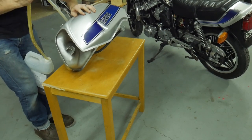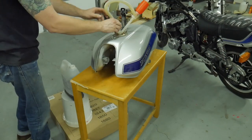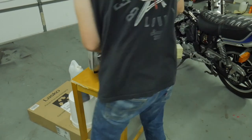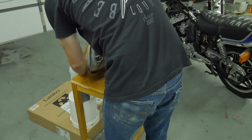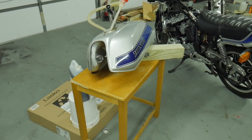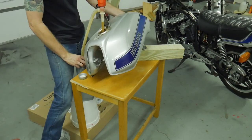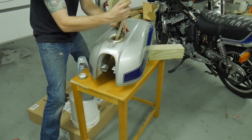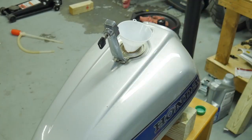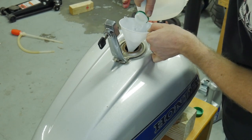Something like distilled vinegar is what I use here. We've got about five gallons and we want to fill it up to the brim. This is me sucking out the old residue. You'll see a technique I use quite a bit, which is just trying to puddle or pull everything to one side. The main issue with using a low acid as a cleaner is that it does etch the metal — etching the metal is a term used when you cut into the protective coating of metal that's inside of tanks, leaving an imprint, and it's no longer protected.